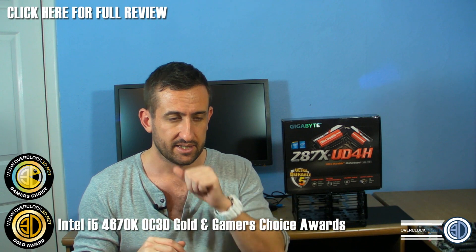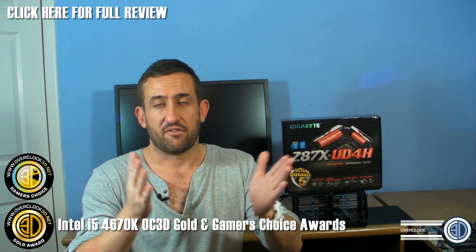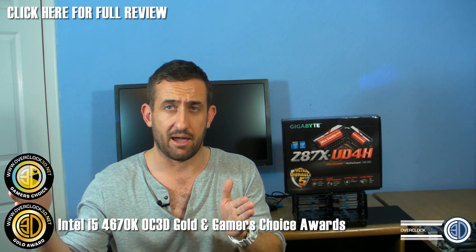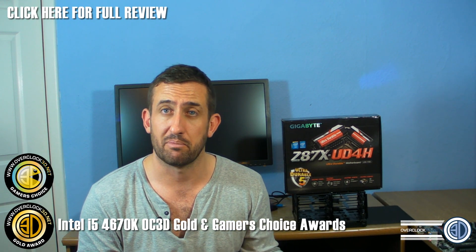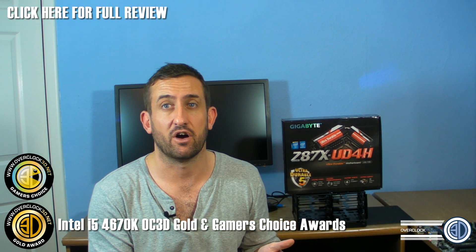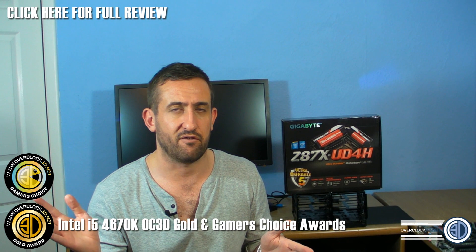If you want to follow our overclocking guide, you need to start at the bottom with these and slowly work your way up, because you'll get to a point — say 4.4GHz at a decent amount of volts — and then it takes an enormous step to get it to go any further. With the 4670K I've got here, I got 4.8GHz out of it, which does seem to be a remarkable chip, and that was 4.8 at 1.3 volts. It would not go further stable for love nor money. Most retailers are putting these out overclocked at either 4.2 or 4.4GHz around 1.2 to 1.25 volts, and I would say that's a good target to aim for. If you can get 4.4 out of yours at 1.25 volts, I'd be extremely happy. If you then need 1.3 volts-plus to get 4.6, I really wouldn't bother.